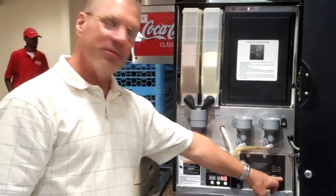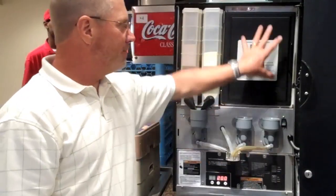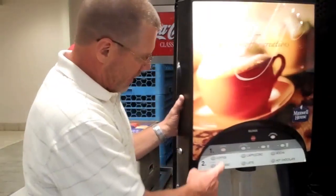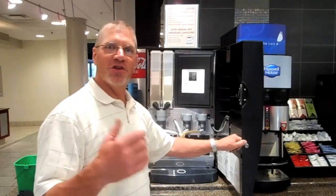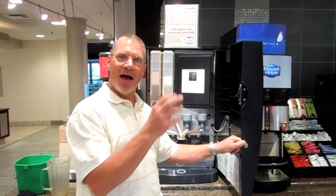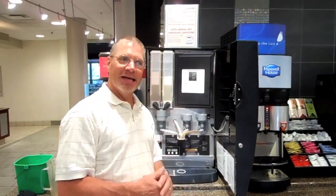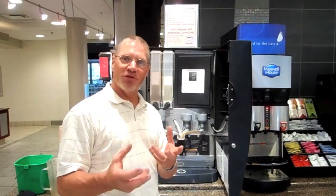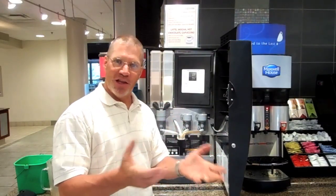Make sure it's on normal, run. If you want to fill this, you put it on prime, push the button in the front — either the decaf or the coffee — that gets product up to the pumps, and then from there you're ready to go. So you've got how to load the coffee, how to serve the coffee, and how to prime the machine. Now we're going to do some troubleshooting, cleaning, and how to reload it again.